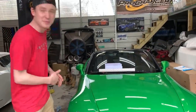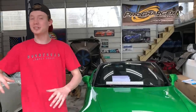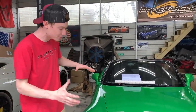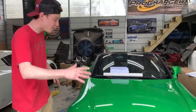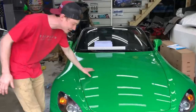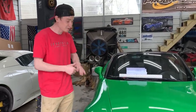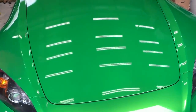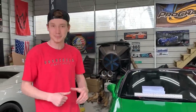This car got a brand new fresh paint job and it turned out absolutely amazing. Honestly, we haven't even taken it down the road since we did that paint job because we didn't want to risk any rock chips — this paint was pretty expensive. Today what we're trying to do is actually clear bra the front end. We're going to lightly sand the whole entire front end and buff it down because it's almost perfect. We just need to get rid of some of this trash up here so when the clear bra goes down it doesn't form any air bubbles.